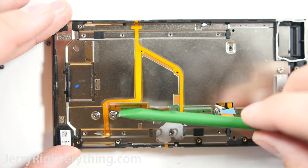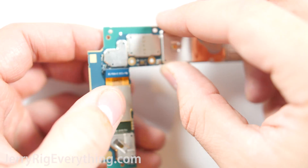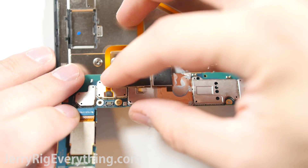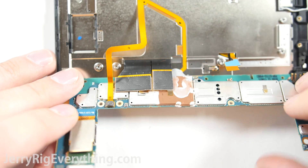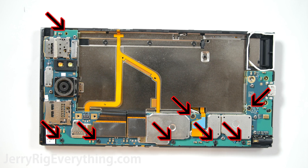The cable will end up near the top of the little slot — there are 8 screws here. Then take your 18 megapixel rear camera and plug it back into the main board. Plug your power button into the bottom of the main board, fold that over, and put it back onto the frame. There are 8 screws holding the motherboard onto the frame.